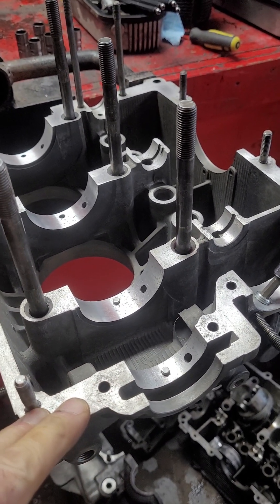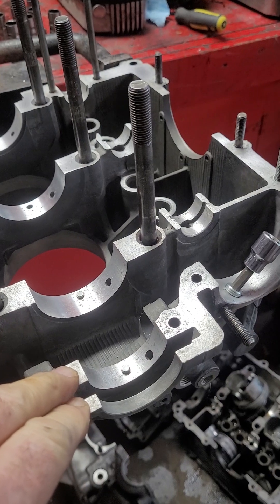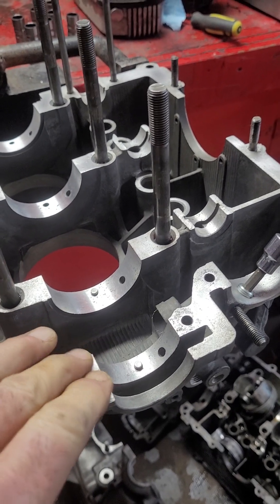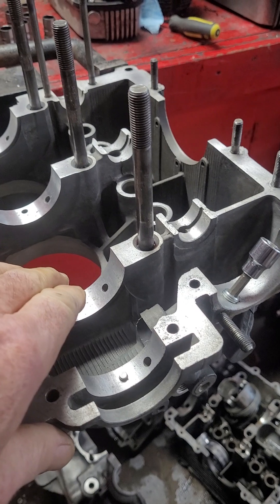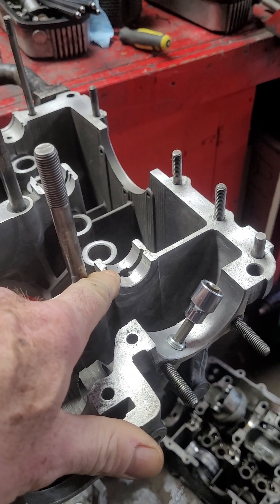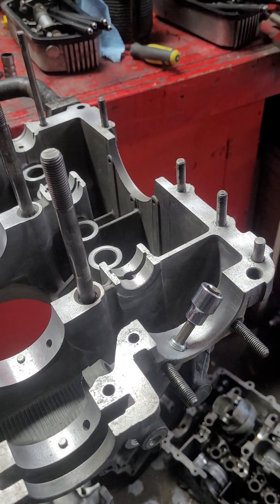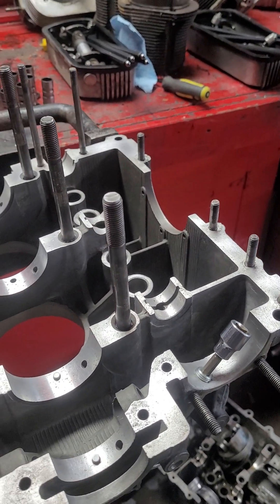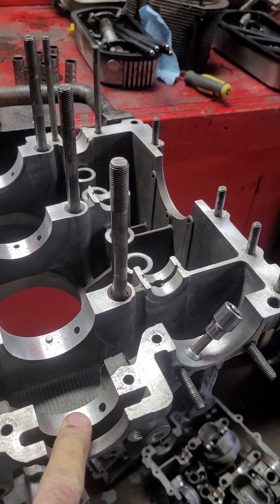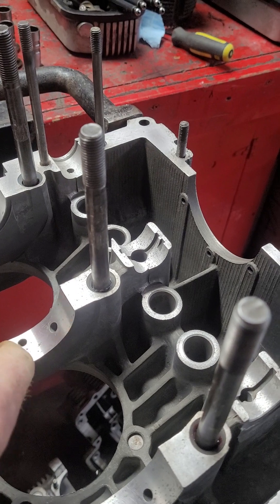This one's been line bored, so I had the deck halves indicated to make sure they're going to be nice and smooth. The cam bore was gauged — it's fine. Typically cam bores are okay, but I had one where I had to remachine both halves of the case and redo the main bearing bore alignment, then also have the case halves machined for the camshaft with a new internal size because the case halves were closer together. This one is first over — it looks a little rough but that's just oxidization under the bearing; it's really smooth.